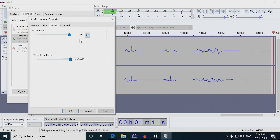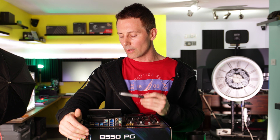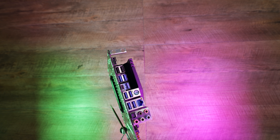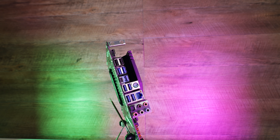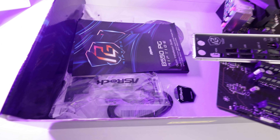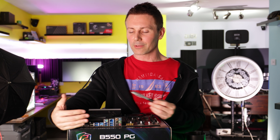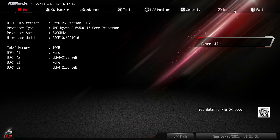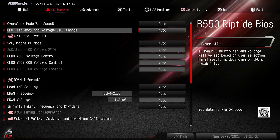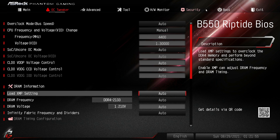To wrap things up, you've got a 2.5G LAN solution integrated, optical out on the audio, and in the BIOS the ability — as stated on the box — to overclock memory up to 4,933MHz, though I doubt any pro overclockers are going to be using a B550 anyway. When I tested 4,400MHz it did boot and was working fine. However, if you're using a 5950X or any Ryzen chip, you'll want to keep memory at around 3,800MHz or lower to get that infinity fabric clock matched one-to-one to your memory — that's important for performance.